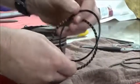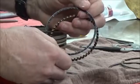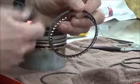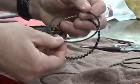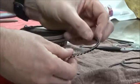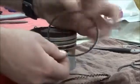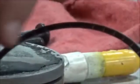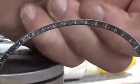Now, you guys that are in the program here, what would you call these little lines that are around here? Witness marks. It's a witness mark, right? So we've got that other video on that. Take a look here, zoom in on that. That's not necessarily scratches. That's where the carbon from combustion has gone past there and kind of stained the ring. Does that make sense? So that's not machined that way. It's just how it's ran its life. That's just a carbon track.